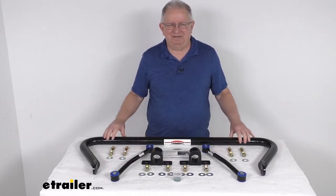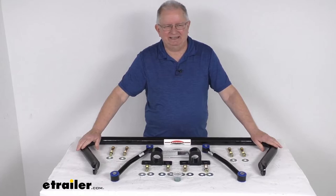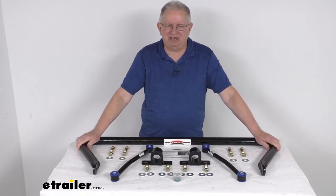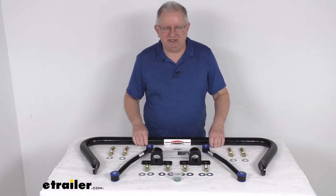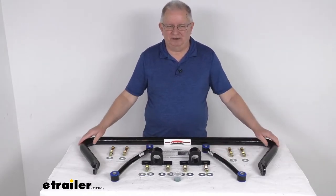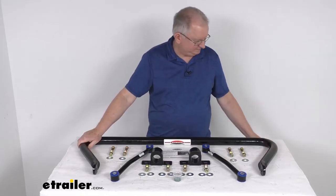Now this is designed to fit your vehicle and work in conjunction with its suspension system. Basically, it'll attach to your front axle and to the chassis, and it uses the weight of the axle to brace your frame as it shifts and turns. And it is engineered to avoid interference with most of your popular aftermarket add-ons and accessories.